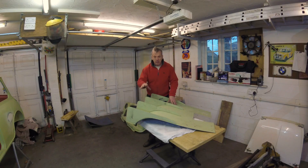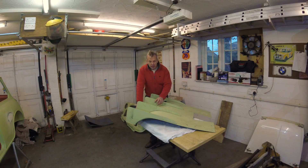The last thing I want to cover today is the rear diffuser — something I made to get a bit of extra downforce at the back end. It also protects the subframe, as it turns out. In order to fit this there's been a bit of cutting and shutting at the back end — I've taken the battery box out, and where the battery box used to be is where the exhaust mounts now fit. The exhaust leg is on the offside, driver's side. If you want to make one of these, just measure up the area to the outside of your subframe to get the width and the length, and allow for the curvature and the bit that fits the rear valance.